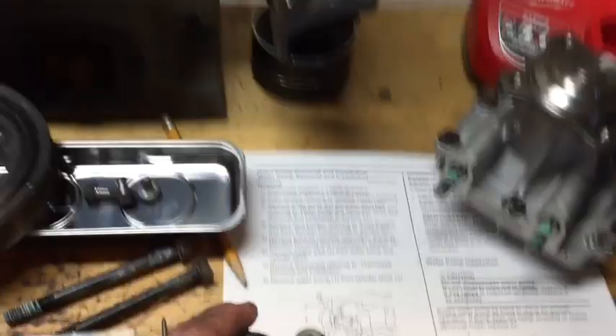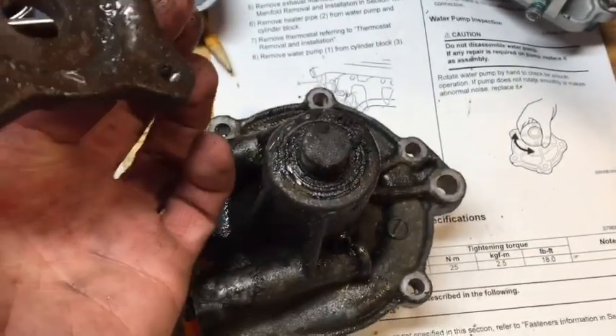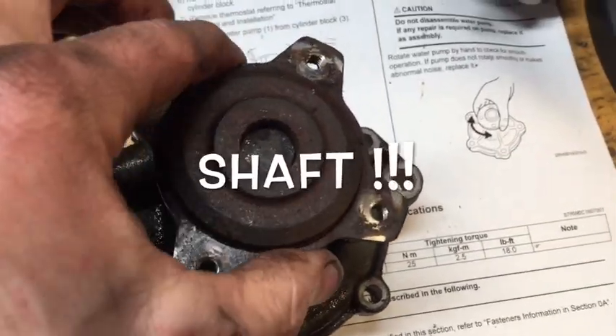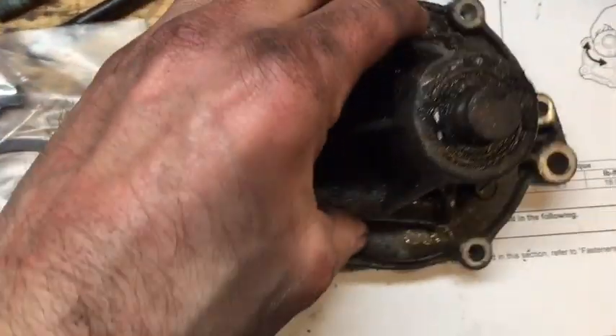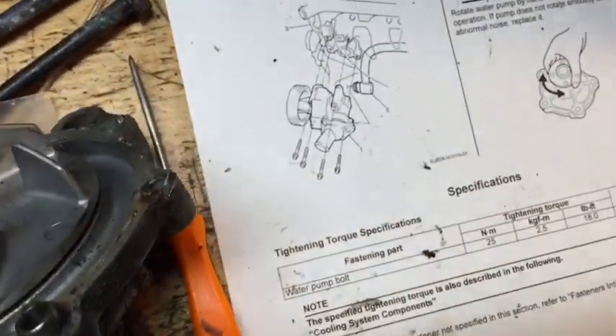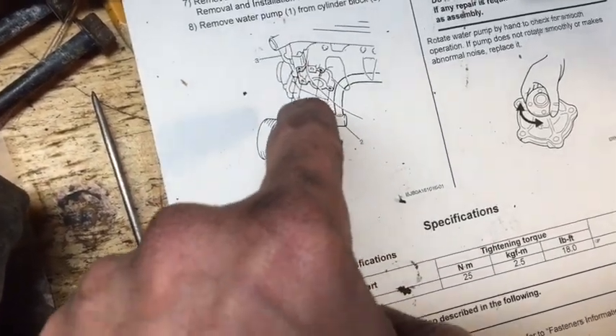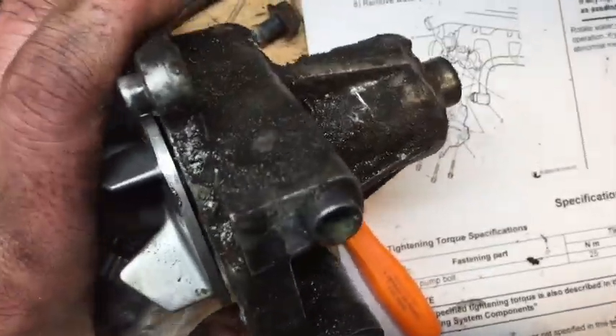There's the pump removed. To be fair, while I was pounding on it to get this off, it did knock the flange off since it's press-fit on. I haven't removed the engine mount but you can see those two bushings — you must take the housing adrift with four bolts, pull it forward, and then you'll be able to extract it. With those bushings keyed into the block you're not going anywhere.